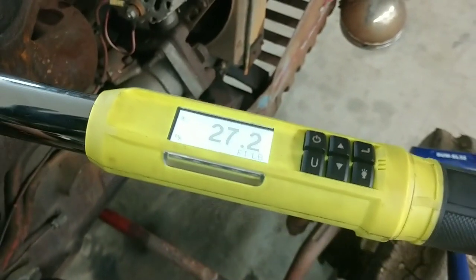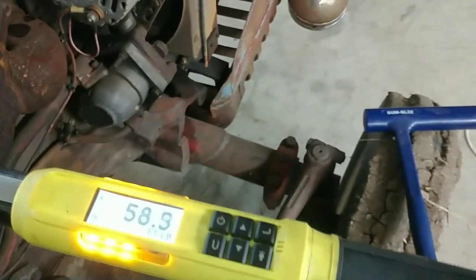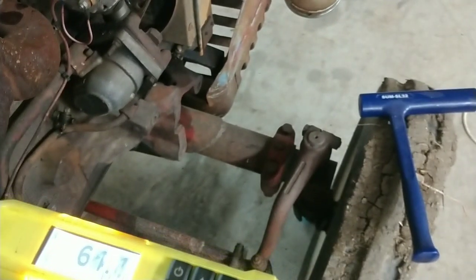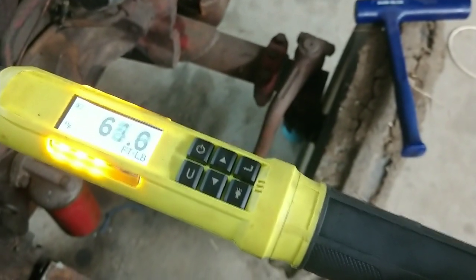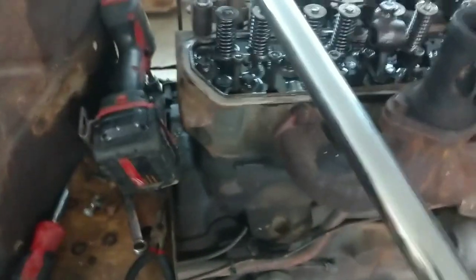See what I'm talking about? I was pretty confident this head just needed re-torquing. We said 53 to 80 — that's more than 20 foot-pounds. The metal just relaxed over the years and over the heat cycles. It just needed re-torquing. It says that all over my 706 manual: after a hundred hours, re-torque and check valve lash.